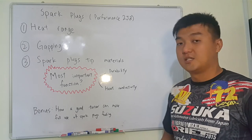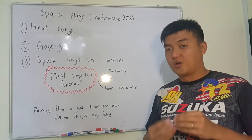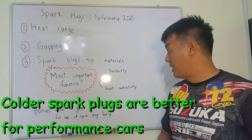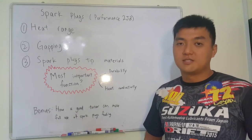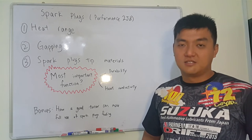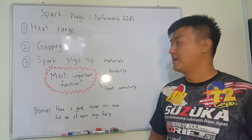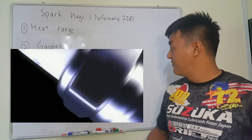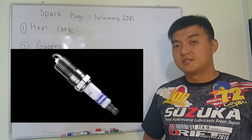You decide yourself based on your needs. For example, silver has very good heat conductivity, meaning it can keep the spark plug cooler and reduce pre-ignition, detonation, and knocking. But its durability is really low — you have to keep replacing silver spark plugs. Many friends of mine using silver spark plugs say they can't stand the durability and have to keep changing them, so it's not good for daily driven cars. Iridium, on the other hand, has a very stable spark and very high durability, though it may have some issue with heat conductivity. But so far it has been stable for me.